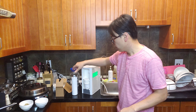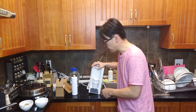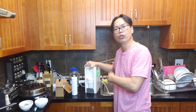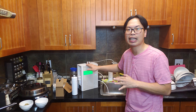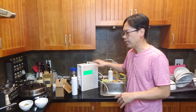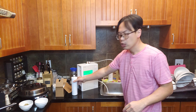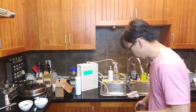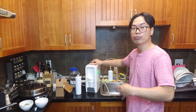Once the cycle is done, if water flow is still really slow, call your technician or dealer. It's almost certainly a dust filter or clogged filter issue. There's nothing in the machine designed to clog the whole thing — it's either calcium buildup inside, a dirt-clogged filter, or a clogged dust filter.